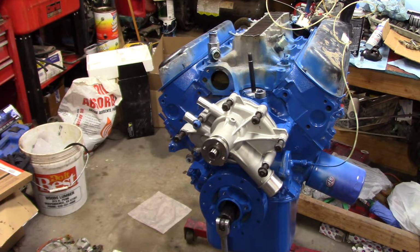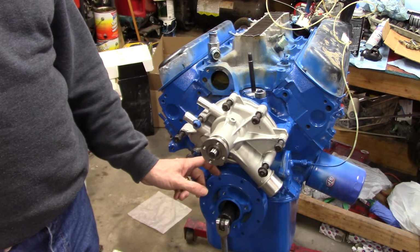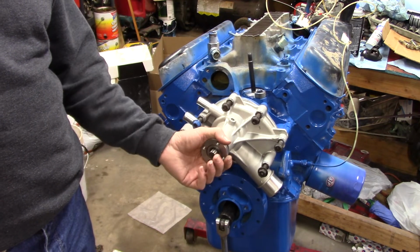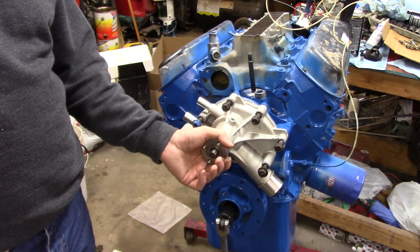When you call them and tell them you're putting a Lincoln engine in a Mustang that many years apart, they'll tell me I have a compressor that will bolt to a 5-liter. You have to make it line up and work with the accessories you have. I guarantee that's what's going to end up happening. The biggest problem is I have a double serpentine belt for the crank, and I've only got a single for the alternator or power water pump, so that throws everything off.